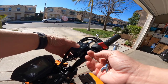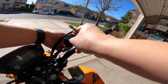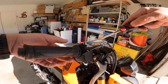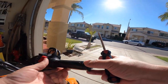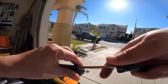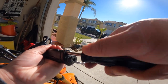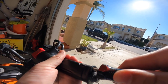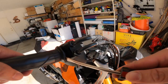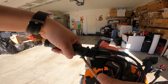Be careful with the brake fluid right here — don't let it tip upside down. I think it gets air bubbles and affects things, so just keep it right side up. Leave this bolted on because it's actually easier to remove the throttle and the grip with it bolted on so it doesn't slide. I'm removing this because I want to use the throttle tube for the new grips.